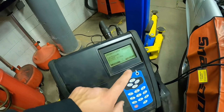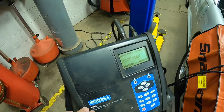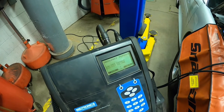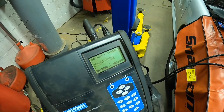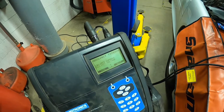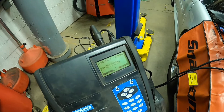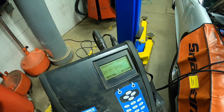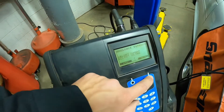This is a regular battery, so we're going to go ahead and hit regular. I want to limit current, because remember we talked about in our lesson that we do not want to overcharge a battery or charge it too fast. Charging a battery too fast causes it to overheat — good job, David — and that also shortens the life of the battery. So a slower charge is better if possible. We're going to limit current and hit next.